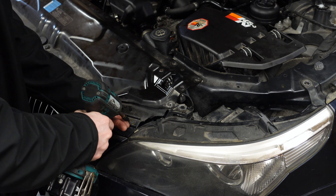Now I've got the bumper released. There are two 8mm bolts you're going to have to remove that hold the bumper to the fender, and you can see the headlight is now free to come out. We do have Torx bolts underneath that sit on a bracket that we've got unbolted as well, so we are just going to have to stick our Torx all the way in the back here and release them. That's the whole headlight out — we're going to take the plugs out just like that, and that's the headlight out.